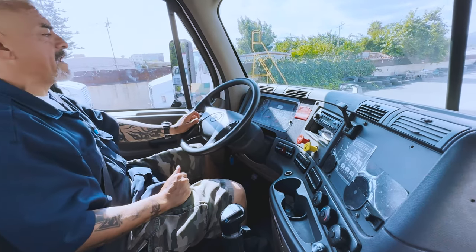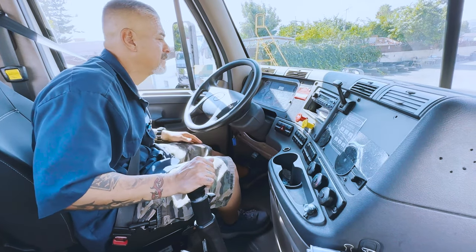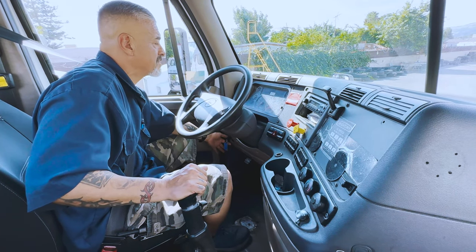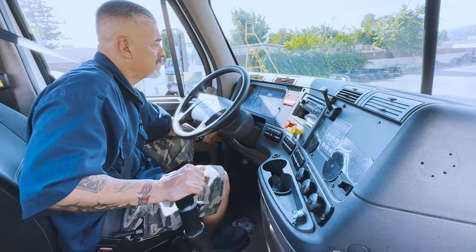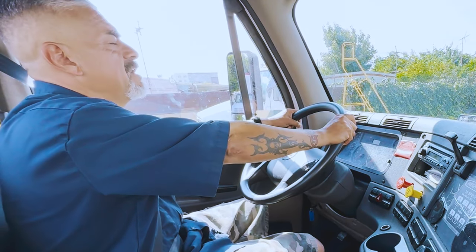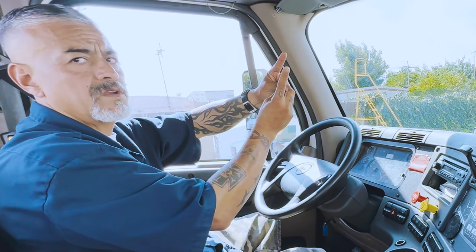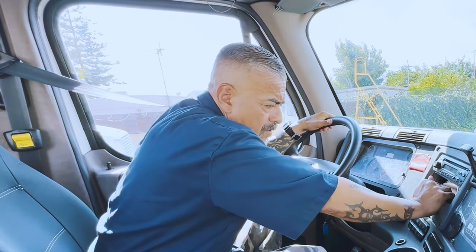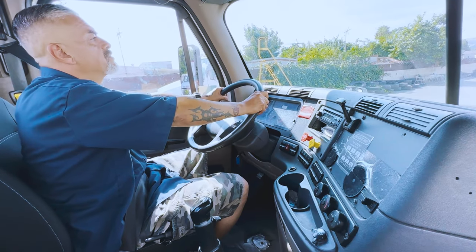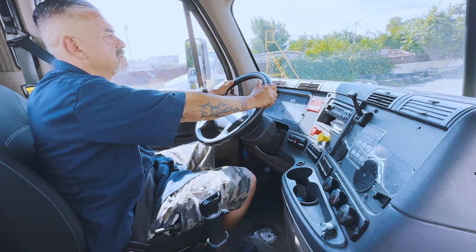I'm going to continue with my apply test. I'm going to place it in low gear, which is first, and shut my truck off. When you shut your truck completely off, make sure you turn the key back to the on position. If you don't, when you do your low pressure warning test, your warning light and buzzer will never come on. Now I'm going to release my parking brake and trailer brake. Wait for my pressure to stabilize — stabilize means when the needles stop moving. Once your pressure stabilizes, let the examiner know you're going to apply pressure to the service brake and wait for your pressure to stabilize again.